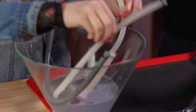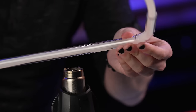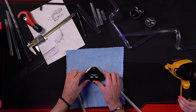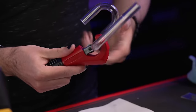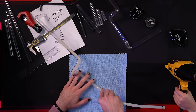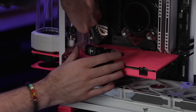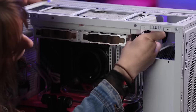The coolant pipes are made of PETG — polyethylene terephthalate glycol — which has a relatively low melting point of 230 degrees Celsius and an even lower glass transition temperature of 85 degrees Celsius. It's very important to heat these pipes very evenly and slowly so as not to create hot spots or melt through them, and once soft enough, form the bends both quickly and precisely. Now that all coolant pipes are bent to spec, cut to length, and filed smooth, we install the pump and reservoir with its mounting bracket and fit each coolant pipe into place, connecting all components in one continuous loop.